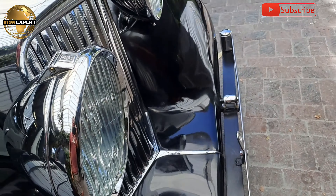So we've had to weld the stud in there and put a bolt through it as well, because otherwise the threads won't work. And that's then going to go in here. Hopefully we get rid of a bit of the play. There we go. So we've made up a complete new drag link. We're using two tie rod ends of an Isuzu KB 4x4 Bakkie. So let's see now if we get rid of the bloody steering play here.